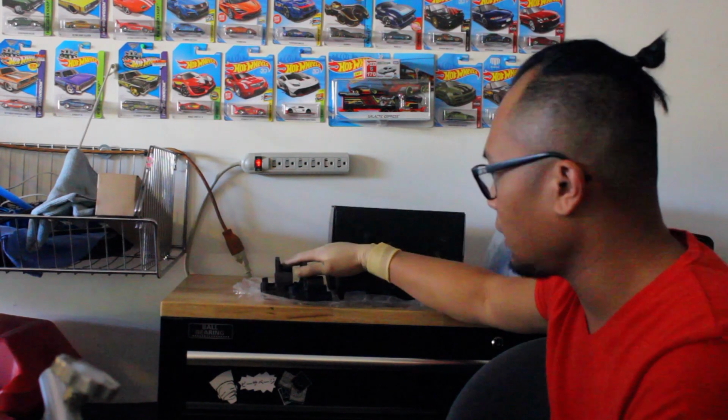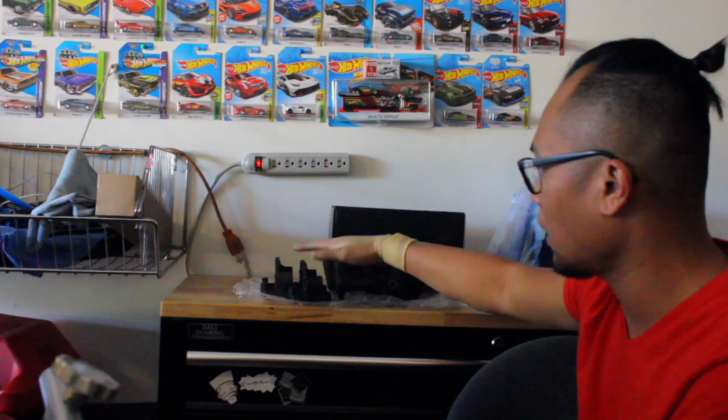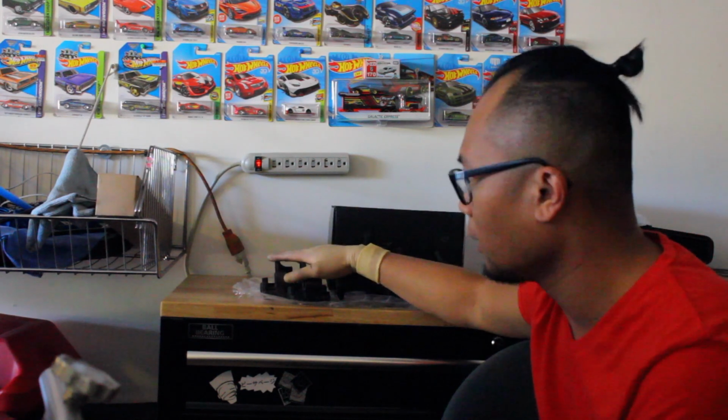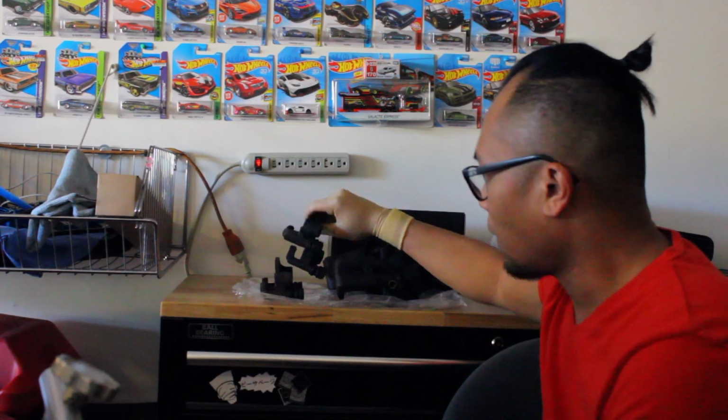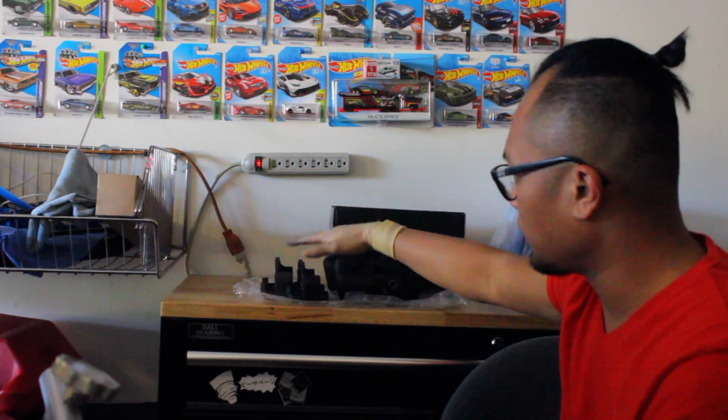But yeah, so we went ahead and changed everything to the new reman ones. We changed pretty much all the hardware except for the brake plates, I don't even know what they're called, that go onto the actual caliper bracket. I didn't replace those. For some reason I never do. As long as it's not broken, these will work. But yeah, we went ahead and changed everything. The only thing that we've got to do now is bleed the brakes. I'm not going to do that on camera just because it's going to be monotonous and repetitive.